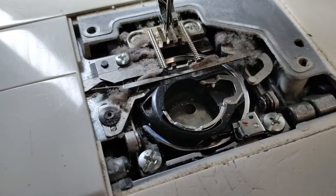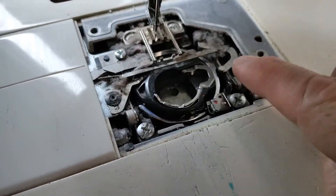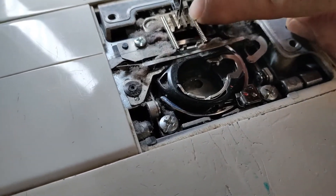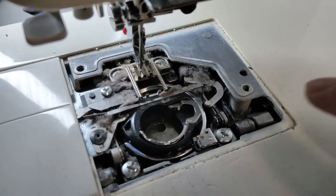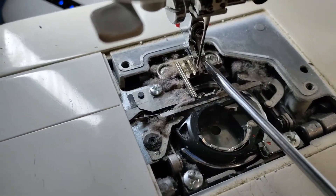It's really important to keep your machine clean between servicings. That means getting out all the lint buildup that ends up inside machines. The feed dogs get packed with lint, which keeps them from being able to move up and feed the fabric. You need to get in between there and clean that stuff out.